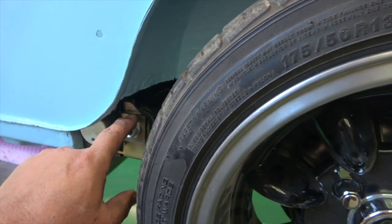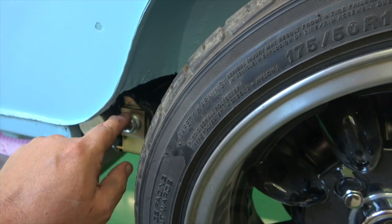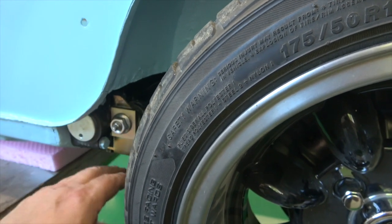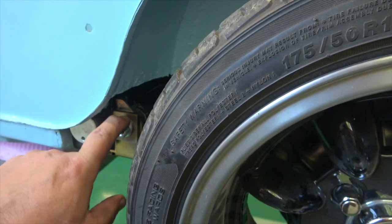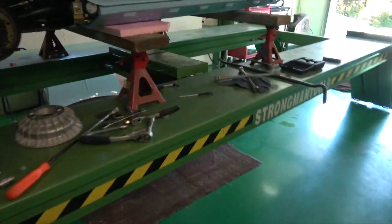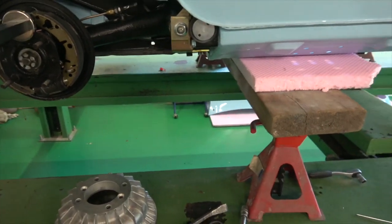On the back plate there's a square opening for the pin to go through, and we had to put an arch into it with a die grinder to give us the movement up. After the bracket was adjusted correctly, we didn't have enough movement — we needed to move it up about half a mil, not even a mil, but we had to use the die grinder to clean it out. These brackets are around £50 from Mini Sport; if you go for the CAD ones, which are better brackets, they're £131, so you have to work out what you want to do.